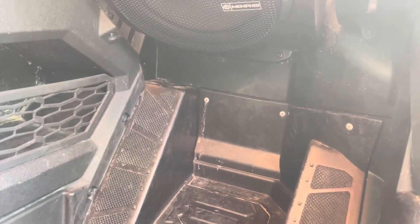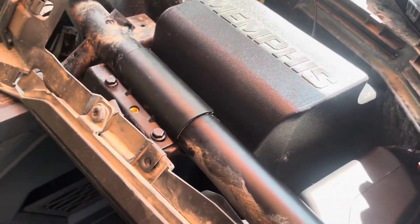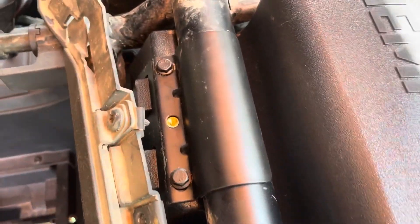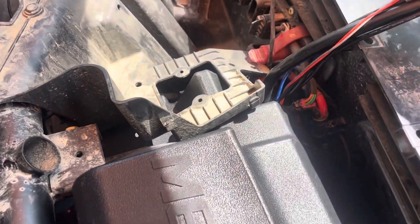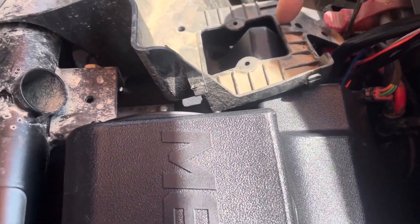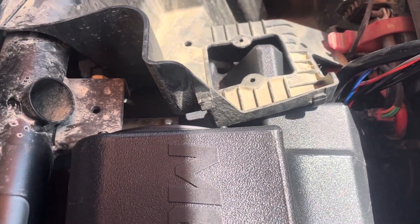For the subwoofer install, it does come with two metal fasteners — the two will slide in on each side where the bottom is going to mount. Set the subwoofer on the floorboard flat and go up into the dash with the top first, and it will go up into place much easier. Once the bottom bolts are in, the top bolts have metal clamps around the bar. While pulling the woofer up, make sure to pull the wiring up as well. One thing to note: I am going to cut this bracket here, as that subwoofer box does hit it, making it a little tighter on the battery connections.